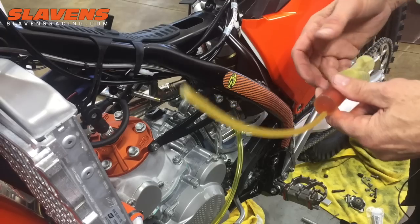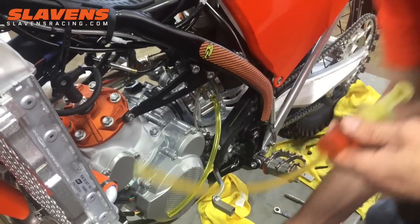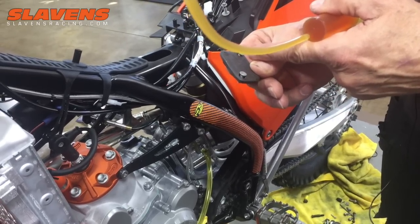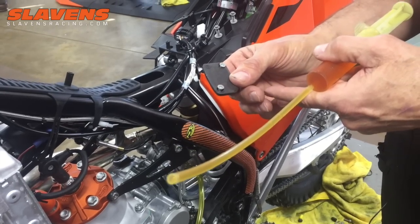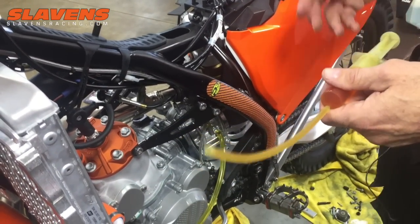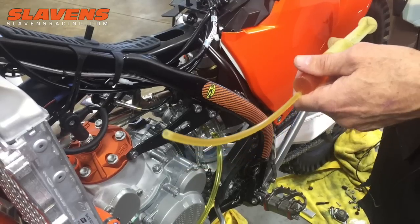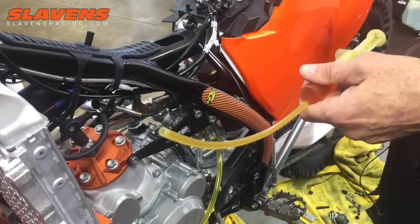What it does not have is brake fluid, because most of the KTM models require brake fluid in the clutch. If you look at the top of your master cylinder cap, it tells you on there — this one says DOT 4/5.1, which means it's an alcohol base. So it'd be DOT 4 like the Motul that we sell, or DOT 5.1 which is not as high a performance fluid, so I would not really recommend that. The Magura kit comes with Magura blood, which is for Magura master cylinders that say mineral oil on the cap — so do not put that mineral oil in your system that's designed for brake fluid, or you'll have to replace all the seals. It will just destroy it.